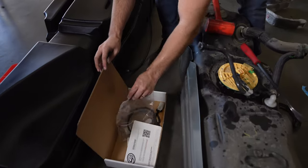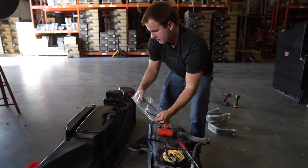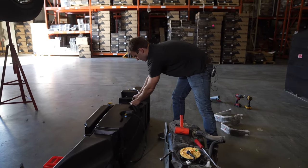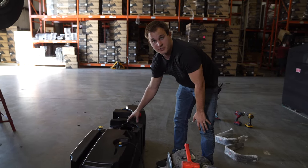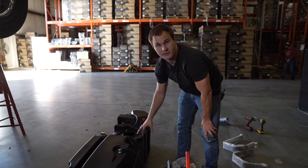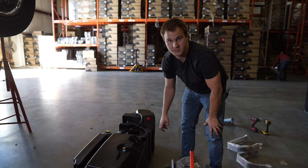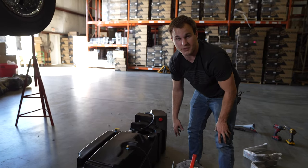Find the included OEM o-ring and place it into the S&B tank. Before proceeding, check the inside of the S&B tank for any foreign debris — stick your hand in with a flashlight or phone and take some pictures to make sure nothing got inside during assembly or shipping.